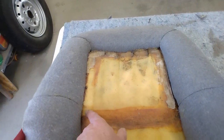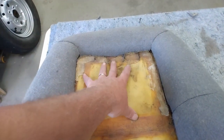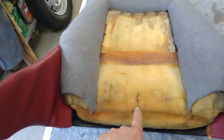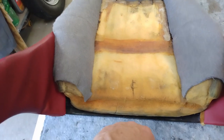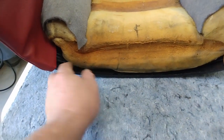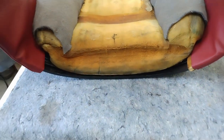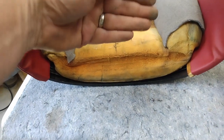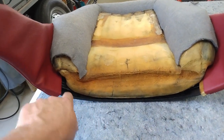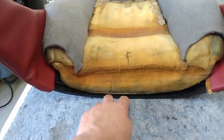Based on what I'm seeing on the original cushion, it looks like the center panel was actually glued in across here. So I'm going to do that as well, being very careful to make sure everything's lined up with the center line, particularly down at this end where it's going to meet the seat base. The cover is secured by a metal lip underneath the cushion — the front part of the cover comes down over that and the clips push onto there, and then the piece coming around the back folds over the bottom lip and gets clipped onto that one.